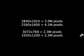If you do need to dial back your resolution, like I need to in Overlord, the digital TripleHead2Go handles scaling very nicely. Here are some sample videos shot through my Sony HDV cam, showing how the unit handles the native resolution and comparing that to 3072x768 and finally 2400x600.